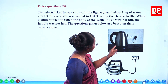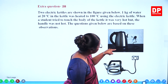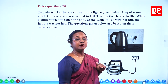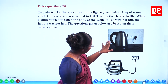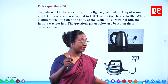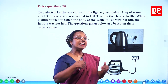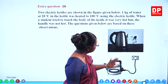In the other electric kettle, there is a hot plate at the bottom and the kettle is placed on that. The heating coil is within this hot plate structure. When the kettle is in contact with the hot plate, heat is transferred by conduction from one surface to the other, and from there heat is conducted to water. In both it is the same principle, but the kettles are made slightly differently. In one, the wire is directly attached to the kettle. In the other, the kettle has no wire — the wire is connected to the hot plate. This is an additional advantage: you can move the kettle around without needing to move the wire.